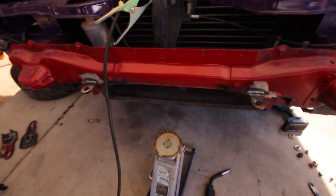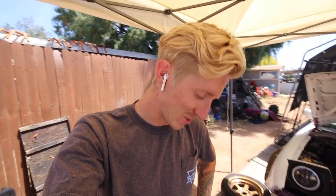Tabs are welded up — they should be good. I'm going to let this cool off for a few minutes while I cool off too. Summer's coming so quick — last week it was in the 70s, today it's almost 100. We've got 100 degrees tomorrow, 102 the day after, and high 90s after that. I don't do Arizona summers. I've got to find some bolts real quick — I think they're just M8 1.25s — and then I can hopefully get this mounted up and test fit the bumper.